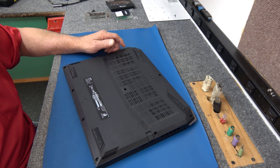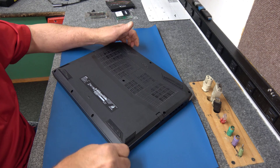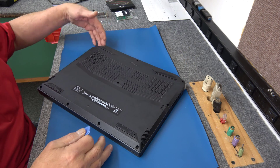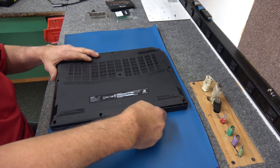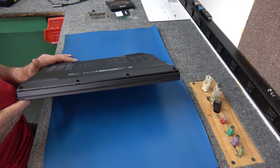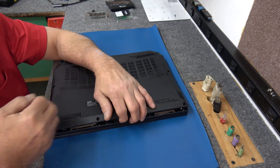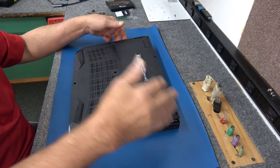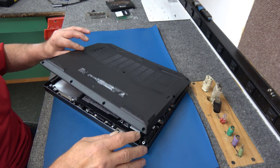Find a good corner to start in, like right here in the front corner in the seam. I'm going to see if I can get my spudger down in there, get it popped up. These can be a little stubborn along the back where the vents are, so you've got to be really careful back there. I'm just going to carefully slide this along — you can hear it popping. You can see it coming loose there in the seam. Always be conscious of your screen — you don't want to be pressing down and putting pressure in places that could do some damage.